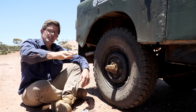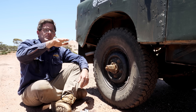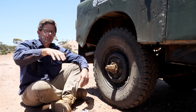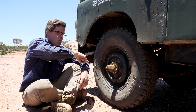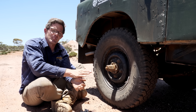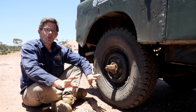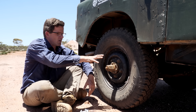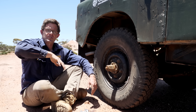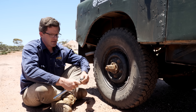The advantages off-road: because you've got a locking differential, particularly when you're going through sand or if you're going up loose escarpments — shaly escarpments some of you might call it — you don't get the tendency of the Land Rover bouncing up the slope, or what you call axle tramp, where the vehicle bounces, the wheel spins or accelerates, and that centrifugal force as it's spinning then hits the ground really hard and puts a shock load through the axle, which ultimately causes it to snap over time. You don't get that because all the torque being provided to the rear axle assembly can actually be put down onto the ground. It'll just crawl like a little tractor or a stoic donkey all the way to the top of the ridge. Really good — makes a massive difference to these vehicles.